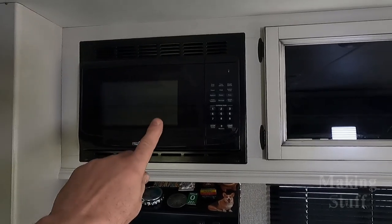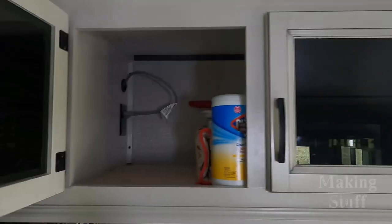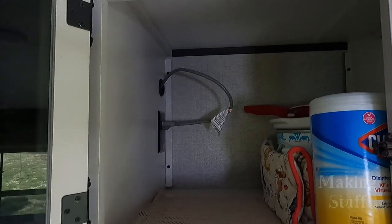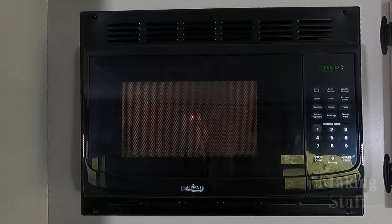In case you're wondering how I'm going to power the microwave — at first glance it looks hardwired into this cabinet, but it really isn't. Opening this door, you can see the cord for the microwave. I unplug it from the trailer and plug it into the power station. I've got a cup of water, I set it for one minute, and it worked perfectly fine with no issues. The microwave pulled about 1500 watts of power from the power station, meaning on a full charge you could roughly run a microwave like this for about an hour and a half.